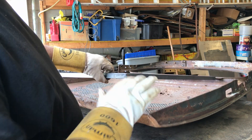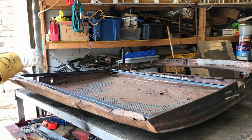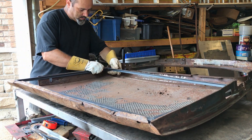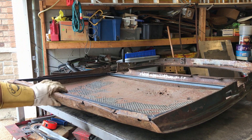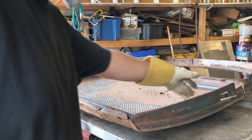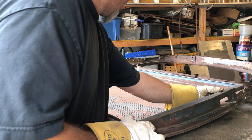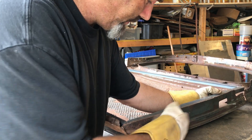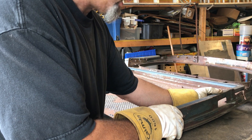Right, let's see if we can squeeze this frame inside the door. Yep, that looks pretty good. I wasn't wanting to bring this section all the way down to the edge because it's really rough. Overall, pretty good fit. I do have the gap at this side to add the thick plate which this will attach to. So now I can make this level with the door jams as best as possible, and then trim off whatever is wavy. And then we can start making the plate up.